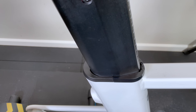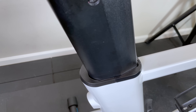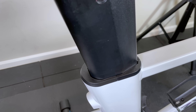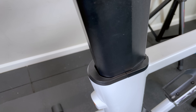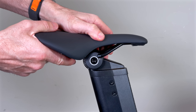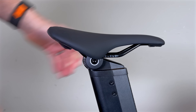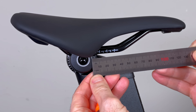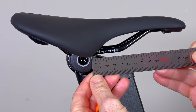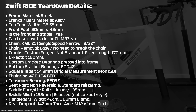There have been a few queries about the seat post and I can confirm it's non-reversible — it can only be installed one way. It is an aero seat post, which means the saddle is always pointing forward, which can be a problem on some indoor smart bikes. The fore and aft adjustment is only on the rails, so you can put whichever saddle you like on here. The usable fore and aft distance is officially about 35mm, though unofficially you might squeeze a few more millimeters out of that.